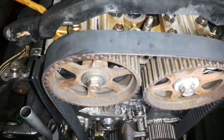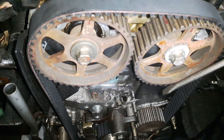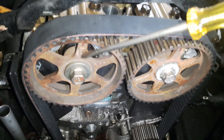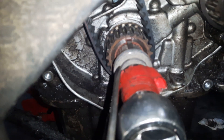Welcome to Wise Monkey. I'll show you a problem with dual overhead cam Honda engines regarding the timing belt. To align the timing belt marks, there are four marks total — one, two, three, four — with an up mark here on the camshafts, and on the crankshaft inside there's a dot and a mark right here. These two have to be aligned.